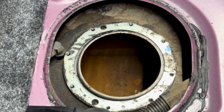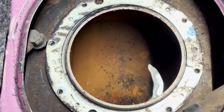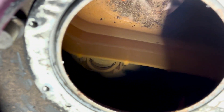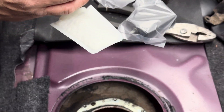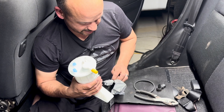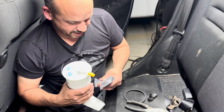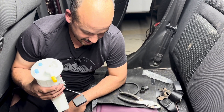There's some trash in here but I can't get it out right now. You can see all the debris down there that's kind of rusty. It's a metal tank, and over there — you can kind of see it — there's a little black spot, a little rust. But this new pump has a filter sock, a strainer, and that'll keep all that rust from going in. If I had the tank emptied I'd definitely try to clean it out, but if the rust ever kills this pump, I'll drop the tank and replace it. But I've seen far worse.